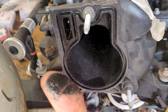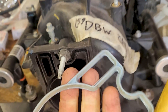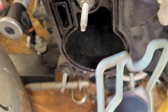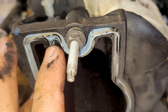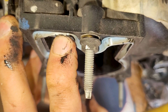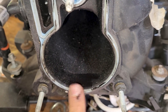You can see how nasty these are. If you have the throttle body off, you're going to want to degrease the inside. Here's another one that can be problematic — it's a silicone seal that fits right in here. It'll get flat, and when you put the throttle body on, it'll suck air right through there and leak. That one's easy to swap out.